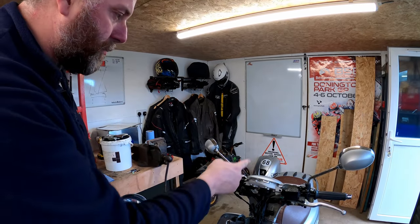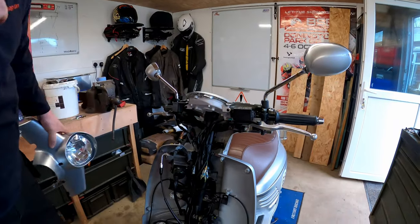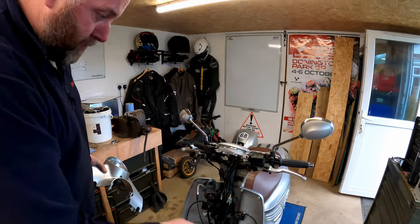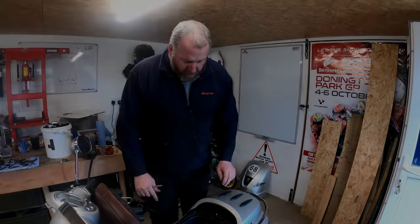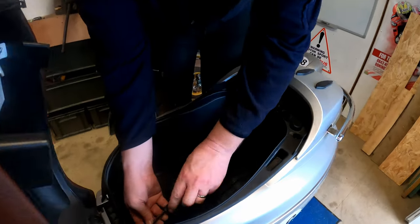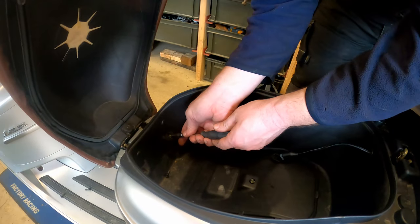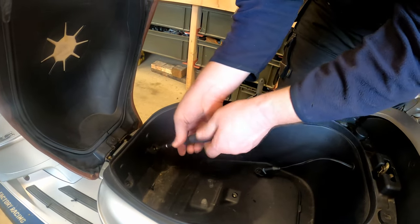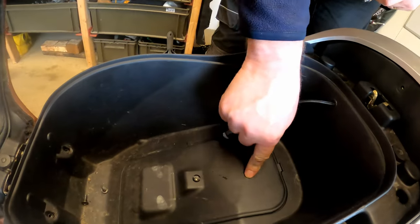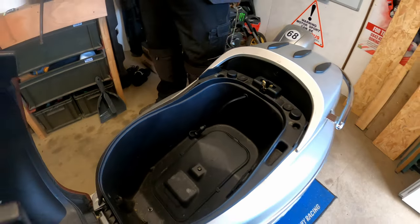Next we'll need to do some of the rear panelling and then probably the footboard. I don't think we're going to need to remove the kick plate — we might get away with that, but if we have to, it's not a big deal. The next thing we're going to take out is the storage box. There are two T25 screws at the front to whip out, and that screw there doesn't need to come out — that's just holding the inspection panel, which is screwed to the box anyway.